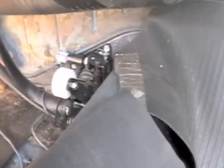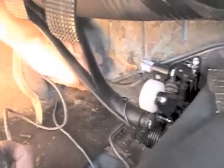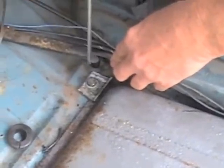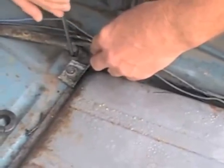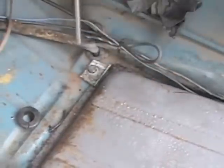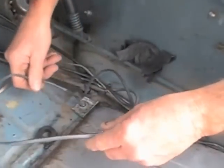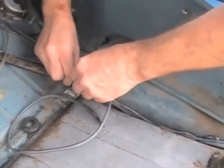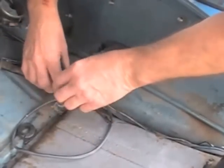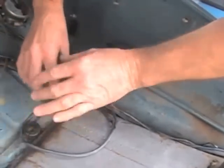I've got the wires hooked up. Now we're going to take the black duct tape here and tape it up against the pan right here at this level. Then we're going to feed it up into the trunk area right up through here where the main wiring harness comes down. Take your screwdriver — this is where the main harness comes out from underneath the inside of the car to where the fuse panel's at. Just widen the hole just a little bit because that's where our cable's going to come through. So I'll go inside the car and feed that out. I pulled the wires through here now and this is where the fuse panel's at. So we're going to connect up into one of the wires here, then go back inside the car and use the duct tape to place the wires against there so they won't move.